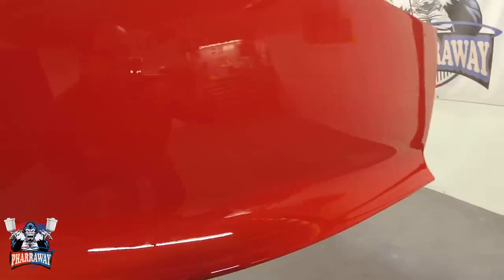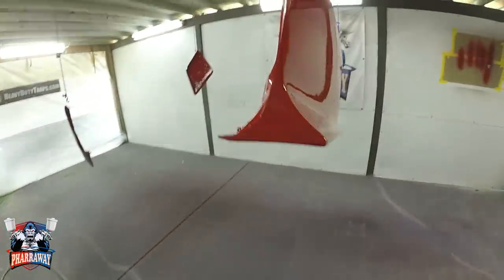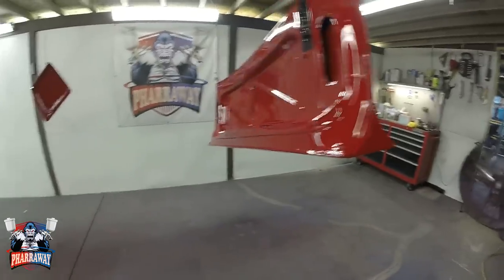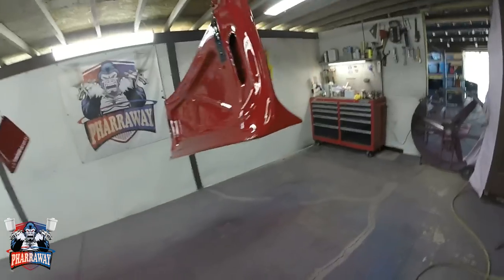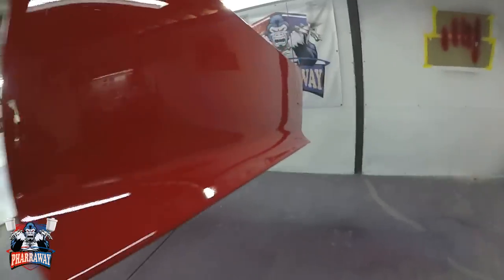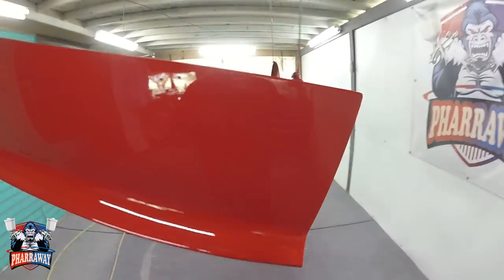There it is, guys. The second coat. Now you saw me doing it much lower, and it was like a 75% overlap, a little bit slower. The PSI was at 33 PSI. Okay, this is the second coat. Now I'm gonna be applying two more coats,